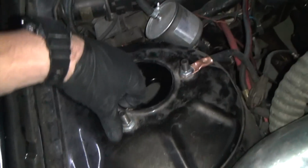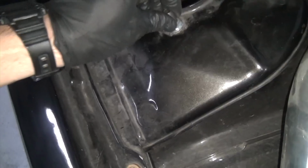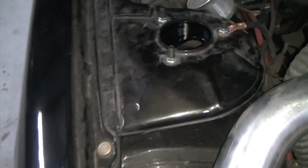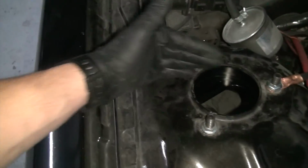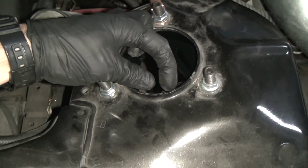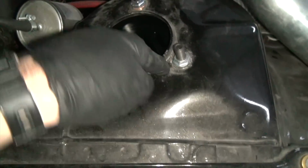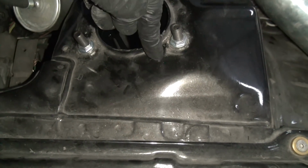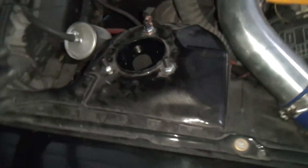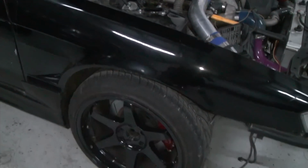I had to take off the top little adjuster, the little clicker, so it would fit under there. But that's fine, you're not going to really adjust them anyhow. Before, the coilover was centered about right here. Now it's right here, which is nice. So the rotating point is right here, rather than right there. So it brings everything forward and over a little bit.